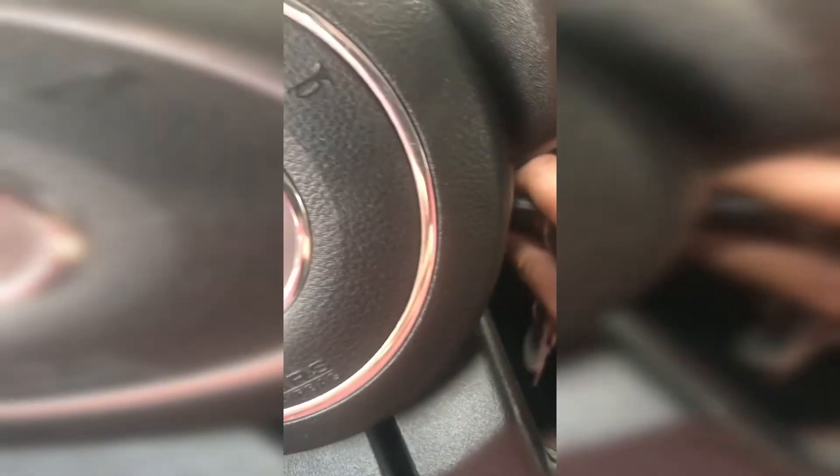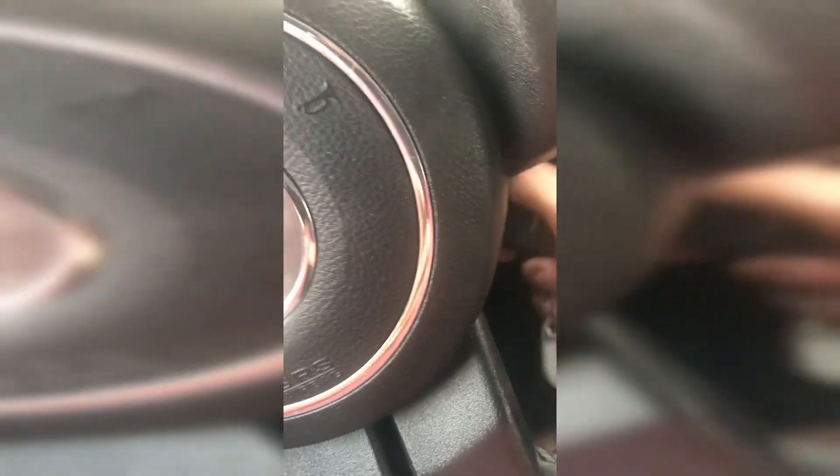You're going to go to the gas pedal and depress it three times — one, two, three — all the way to the floor in sequential order. Then turn the key off and turn it back on.